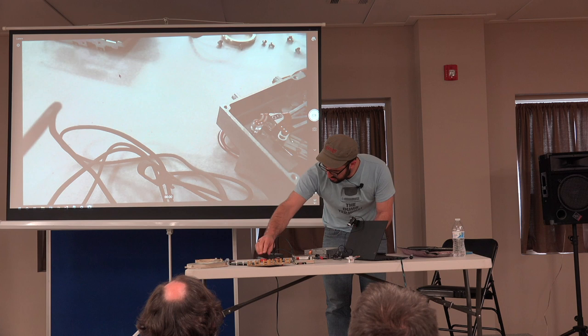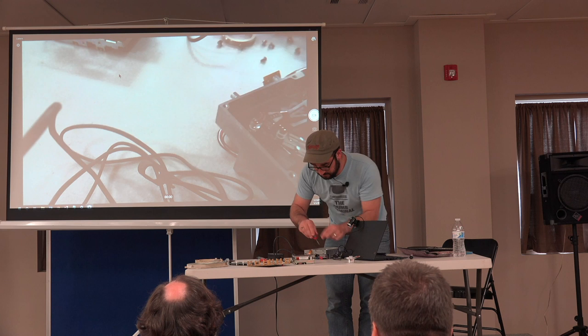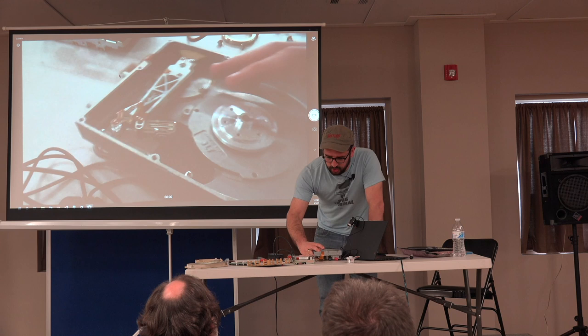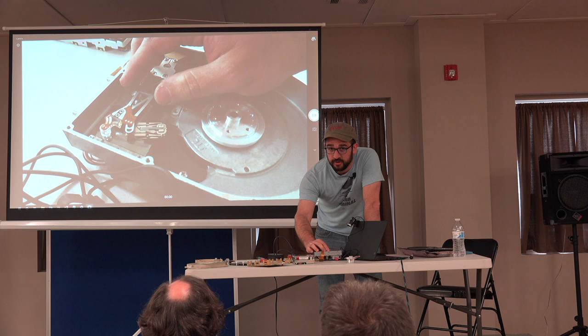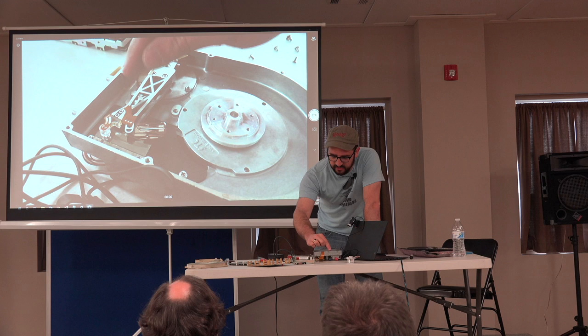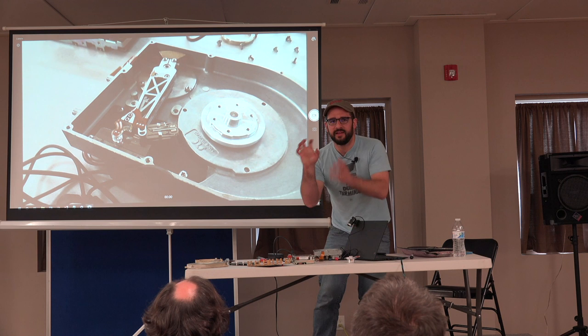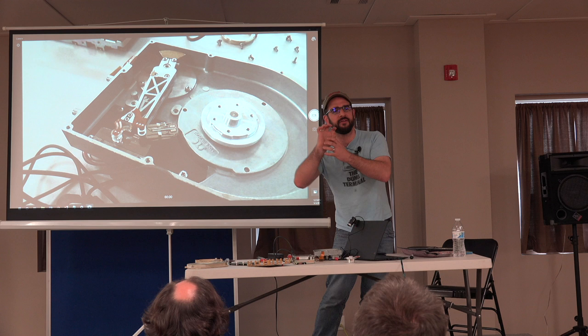So let's take the motor out of this guy, and this will kind of show you. I have a good story for you on that. Yeah, let me get this out of here real quick. So this actually is going to show another problem that this particular drive has. You heard me mention it has a servo, so it should be free floating. Notice how if I bump this, it kind of moves back to where it was. And it's got some notches in it. That's because the grease in the bearings is all turned to goo, and it's kind of gooping back into the place where it wants to be. This drive wouldn't work because the servo doesn't have enough torque to overcome